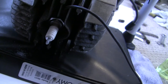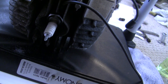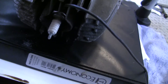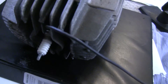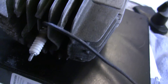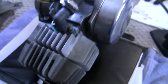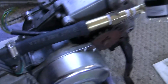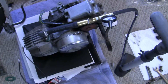Also a big one: your spark plug threads. This spark plug — or any plug I try to put in there — is kind of hard to turn and grimy. Even after I cleaned up the threads as best I could, I was sure I'd have a leak there, but I don't. I'm using a Trail Tech temperature gauge, so I take the washer off the spark plug and use the copper sensor as my washer.